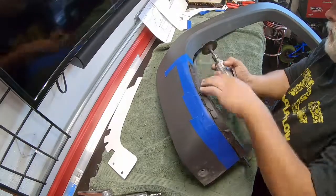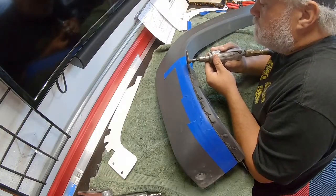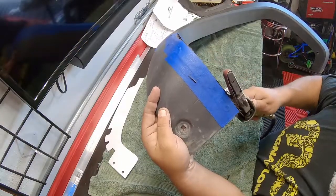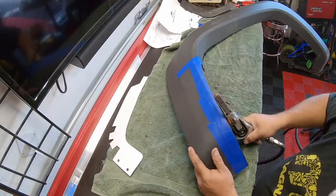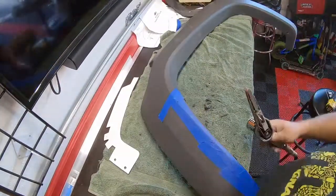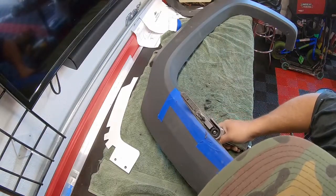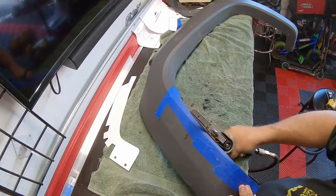When I reach the corner, I spend a lot more time and make smaller cuts to make sure I don't overcut — the blade will catch into plastics and bite a lot quicker. Small cuts, small movements, and make sure you have a nice clean intersection. Once done, pull the material away — unlike metal, don't bend and twist plastics, as it can discolor or stretch and pull material you weren't expecting. Cut all the way through, remove the unwanted material, then use a coarse grit on the detail sander to pull away the damaged and melted plastics before moving to a much finer grit.